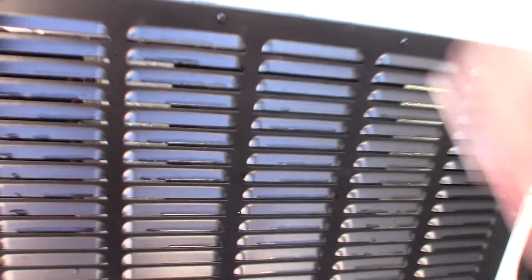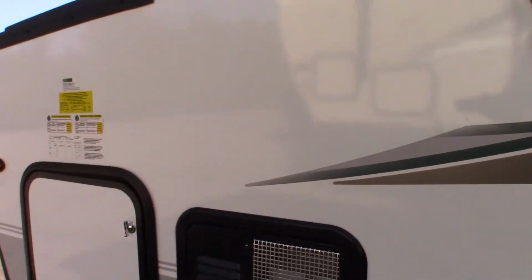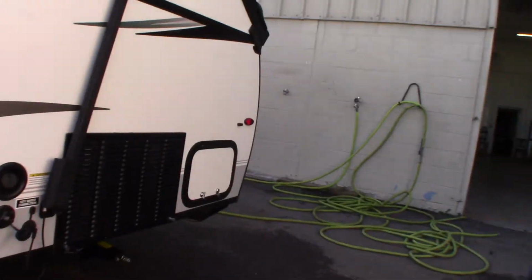This is coax through for campground cable or antenna or whatever you want to use it for. This is the actuator that raises and lowers the roof, and it plugs in there obviously. Behind here is your heat pump. I'll show you where the controls are, but it's located underneath the rear off-door side bench. Well, all these benches will have lids on them that are screwed shut. They're screwed with number 2 square-headed screws, so you need a driver to unscrew those screws if you want to access things that you need to service. The water pump is by here also. If you go to the front bench on the off-door side and take the screws out, you'll see the back of the water heater with the bypass valves there. Okay. All right.